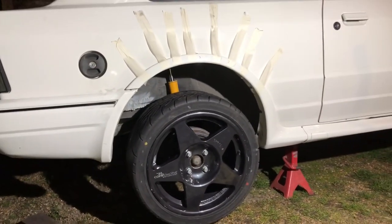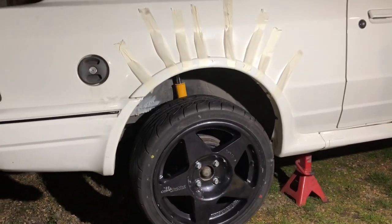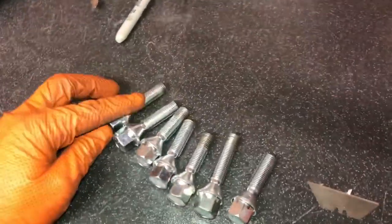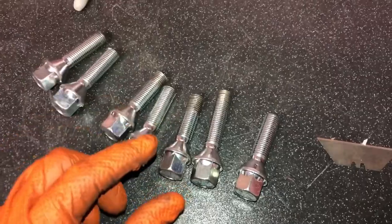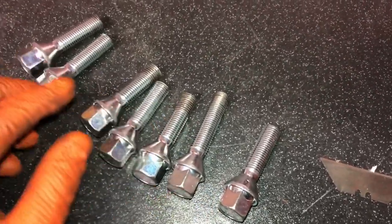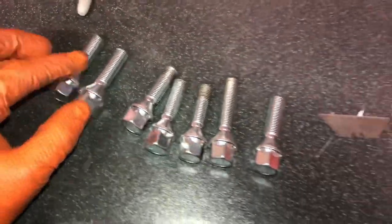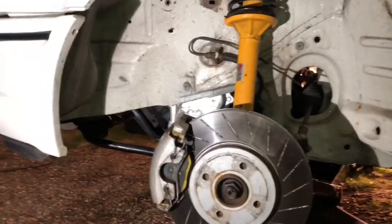It's got dark now but the wheels are on - the wheel bolts have been shortened down a little bit because they were a bit too long for the drums. We've just taped on the body kit temporarily. We took 10 millimeters off the bolts and ball-nosed the end so we don't get any cross-threading issues. We've got nice fresh wheel bolts to go on, and this also helped us work out the correct stud size for the upcoming stud conversion.